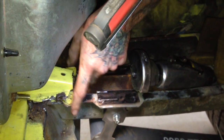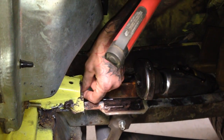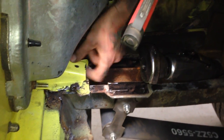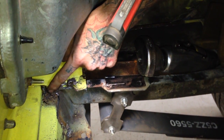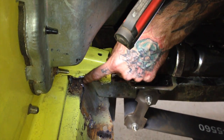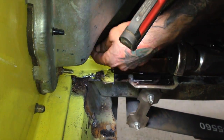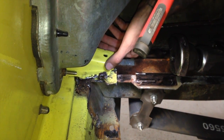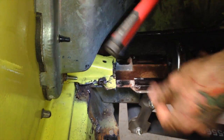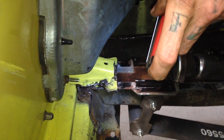I don't know exactly what it's called, but you can see on the other side. I'm cutting away little by little at this trunk floor — I don't want to take off more than I need to. I find rust underneath this and up to here. I can't have my cut line right there right on the rust, I need to come in here, and there's just no easy way to get these off. So that's where we're at now.